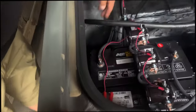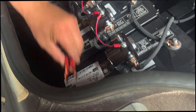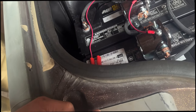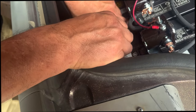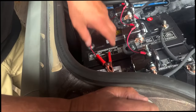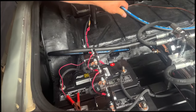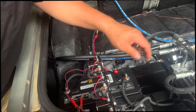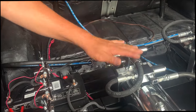So this cable is your first battery, 12 volt, 24 volt. 24 volt, that's the power for your switches. If you ever get a pressure lock, you just take that off and run a wire. Matter of fact, I'm going to make you one. You're going to run a wire from here over to 36 volts, and that'll give more power to the dump. A pressure lock is, if you overlock this setup and you have too much pressure in the line, the dumps won't open. They don't have enough power. You see what I mean? So then we jump it to 36 volts, which will give you enough power, and usually that'll dump it.